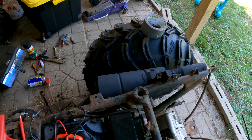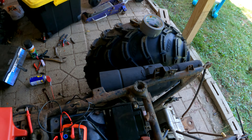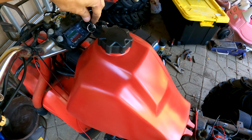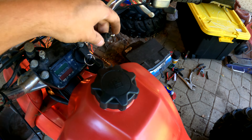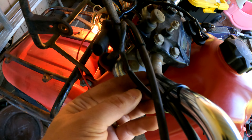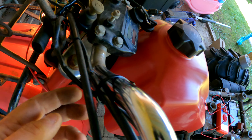Update on the Big Red: I got some new tires for the back — about $100 a tire and $20 to get them mounted at the local Fleet Farm. As far as the electric start issue, I found out the neutral and reverse were just light bulbs that need to be replaced. And for the electric start not working, there is a broken wire right there, and there's also a broken wire coming out of the starter on the other side, so I'm going to get those fixed up.